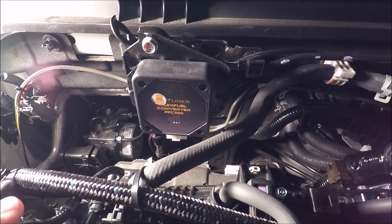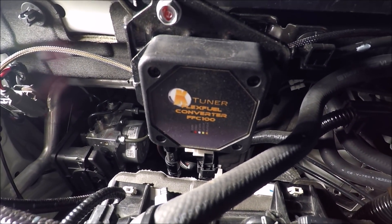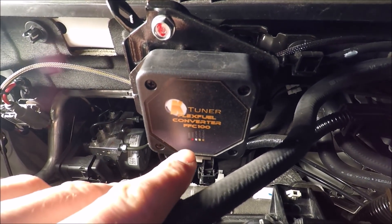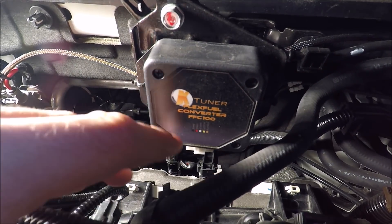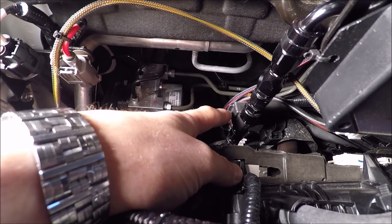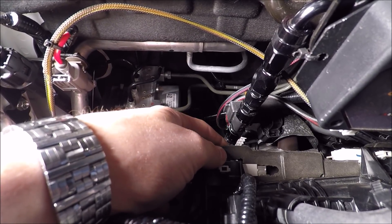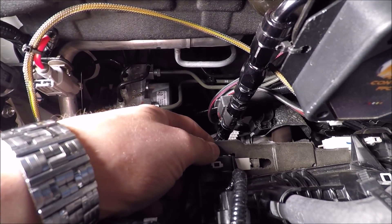I also need to show you something under the fuse box, because I'm going to assume most of you do not have your converter switched to 12 volt like K-Tuner says to do. So let's do a quick rundown of the setup and pricing. One of the crucial components is the converter — it's about $100 direct from K-Tuner, maybe $115 shipped. It needs ground, power, and input, and then it's got an output. The input comes from the Flex Fuel Sender, which I have right here. Mine is a Continental-branded one on Amazon for about $40, so it could be a knockoff. But every time I test my fuel it's within 1% of the readout on the K-Tuner V2, so for now it's accurate — long-term reliability is still up in the air.